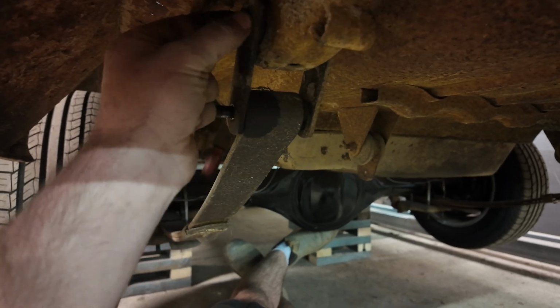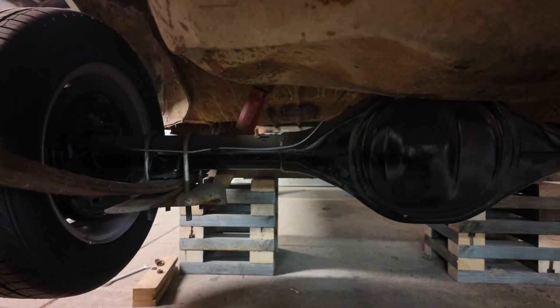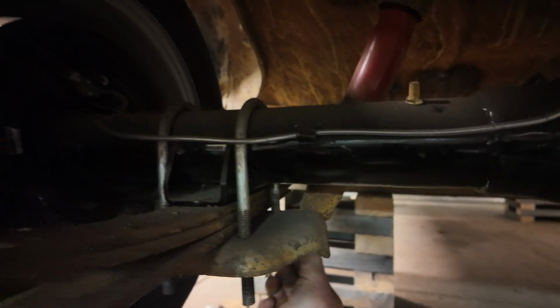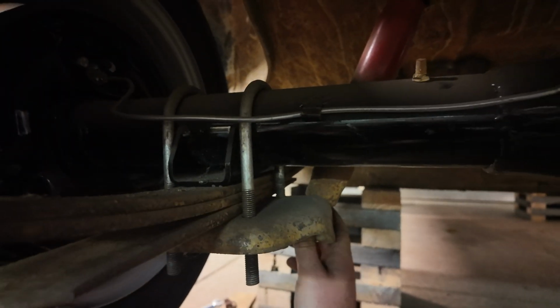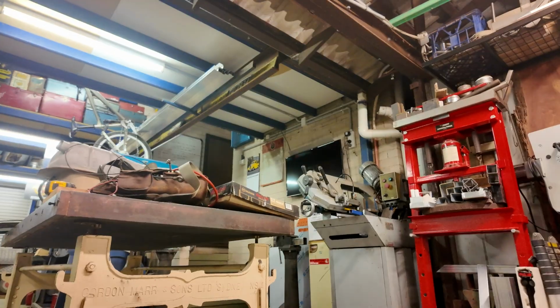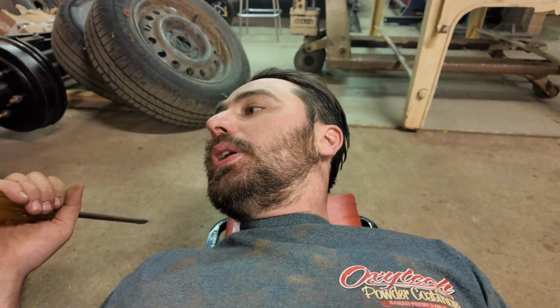Like that. Grab the nut to go with it. Cool. Next I'm going to grab a trolley jack, put it under there, and then I'm just going to unbolt the lower bolts for the shock absorbers, because they need to come off next. Alright, so shocks are off. I've also taken the handbrake cable off the body. That's going to stay with the diff because I can wheel it all out in one big go.